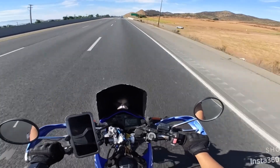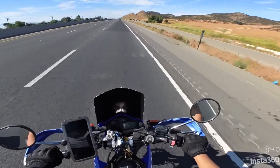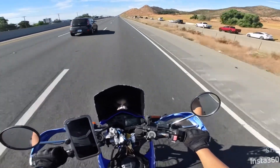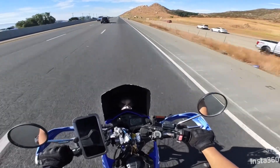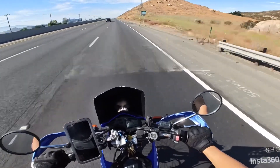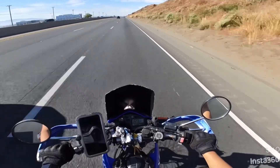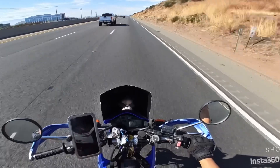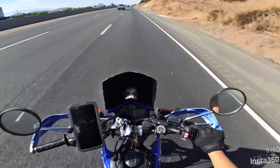The Dynojet is really where it's at, because when you add more air with the airbox mod you need to add more fuel. I'm sure if I threw on an exhaust and a high-flow header it would really wake this bike up. Right now my bike is a bit weighed down with all my luggage racks, and I'm also running an oversized knobby tire in the rear, which definitely hurt performance.